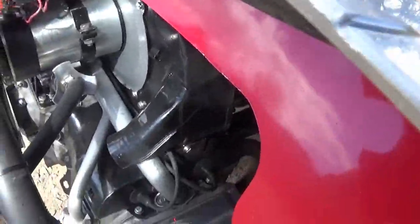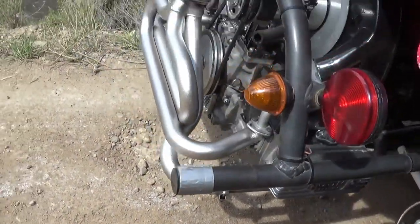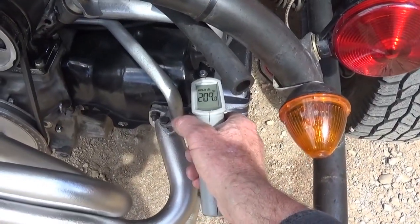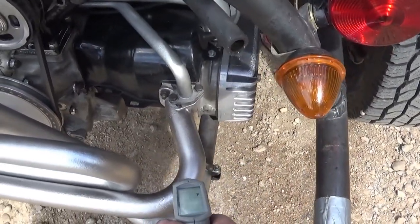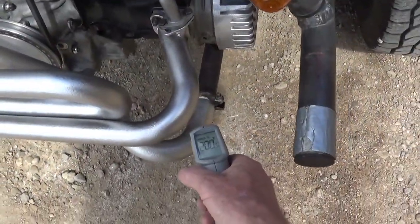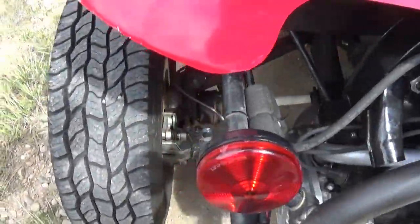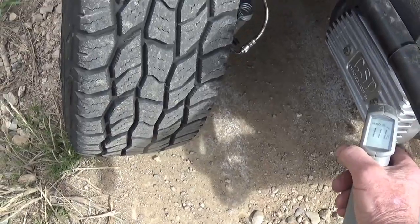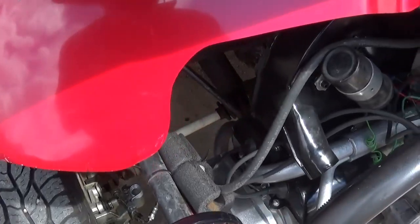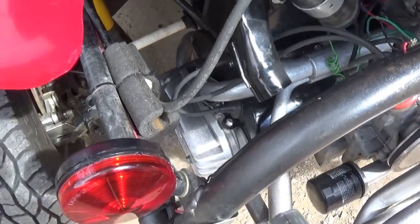These big aluminum valve covers, 103 degrees? That's amazing. The steel ones were more than that. And the head itself, 209. Wow, that's good. The header, 325, 255, 200. Wow. This valve cover, now it can 111. You got to be careful on shiny surfaces. Sometimes these infrareds don't work as well. 209. Boy, that's nice head temperatures.